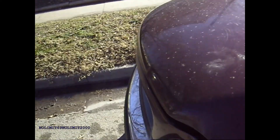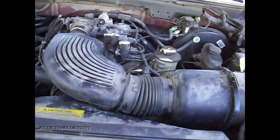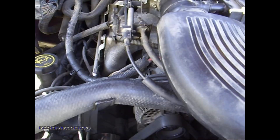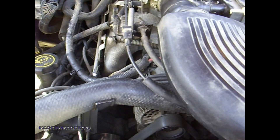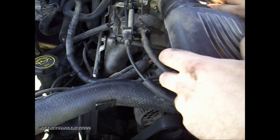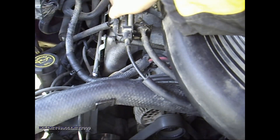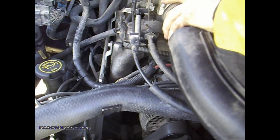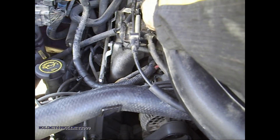I've done a little bit of diagnostics from where we were at the first time. What's happening is the alternator is not getting a charge signal. Somewhere between up here and the alternator, I'm not getting the 12 volts or whatever is required to start the alternator charging.